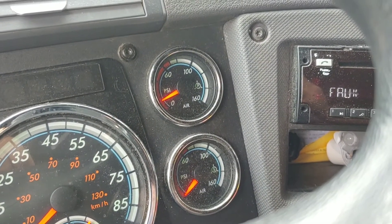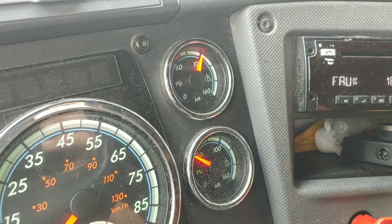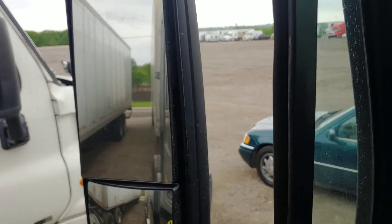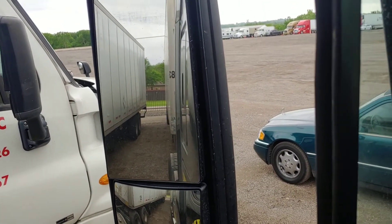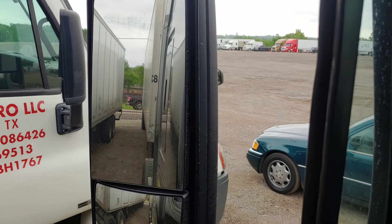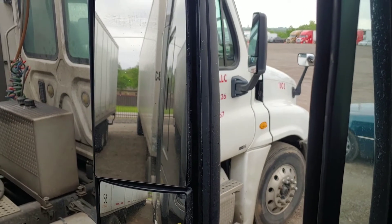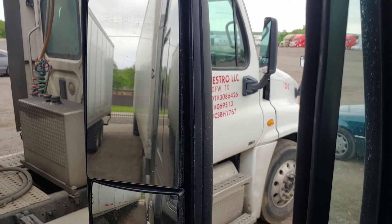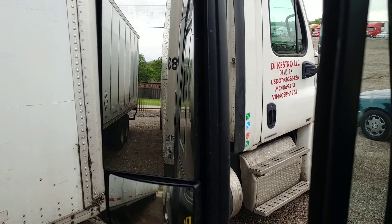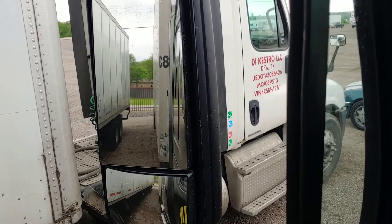Let's do that — wait for that air pressure to come up. There she comes. Alright, in reverse. A little off, but watch the trailer because it should slide. I'm going to back up a little bit of a curve. Watch it. Picking it up. You see how it slid sideways there to the right — which you want to see. And then you just want to test the tug. Tug test. It's moving with me, so we're good.